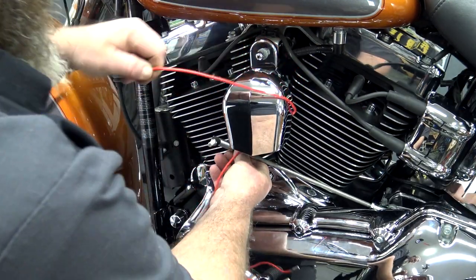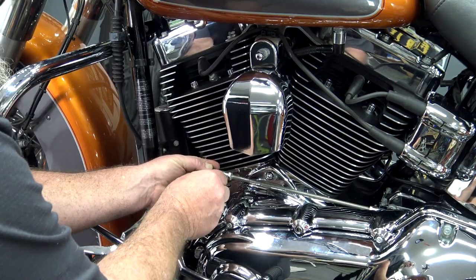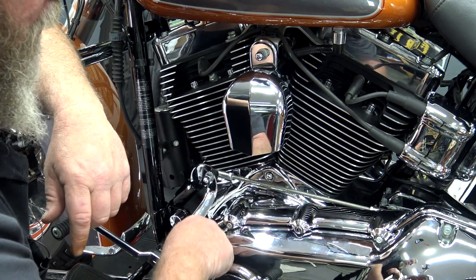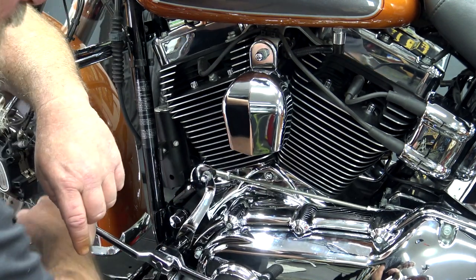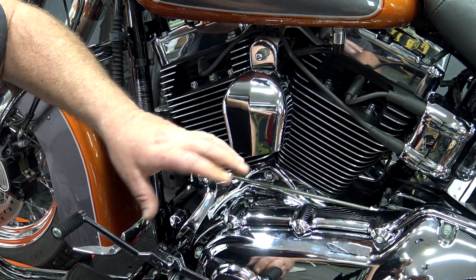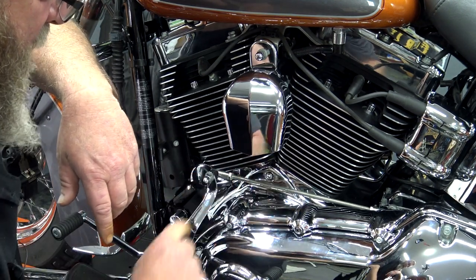Now we can take our wire makeshift holder out of the way. We're going to slide this back into the back side of the shifter — you're going to want to put a little blue Loctite on this. Very important: just like with the inner primary cover, double check clearance of your shifter rod. Make sure that none of this is making contact with the cylinder base cover. Go ahead and shift it just to make sure. This is a stock shift rod, so it's probably not going to make contact, but some shift rods out there are pretty elaborate — some have big designs, thicker, wider. So just shift it a few times and make sure none of this is coming in contact with any of that. If you've never done this before, even with the inner primary cover on there, you're talking maybe five minutes to get it completely installed.